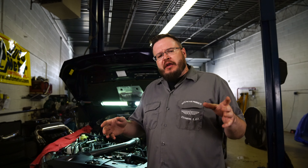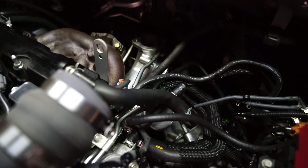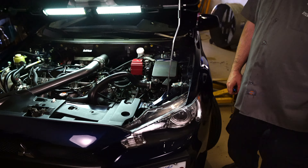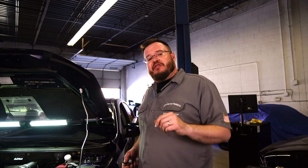In between dyno pulls behind us, we got the new turbo into place. Had to wrestle a little bit with the oil drain tube getting that into the block, but everything's in place. It's 22 foot-pounds on the bolts to the manifold from the turbo, and then a 65-degree turn torque-to-yield. Reinstallation is exactly the same process, only reversed from taking it out. You'll need lots of long extensions and wobble sockets, and probably a good deal of patience, because the brackets that were a pain to take off are a pain to put back on. But everything does line up — no surprises. Just take it slow and you'll work right through it.